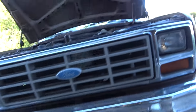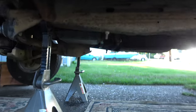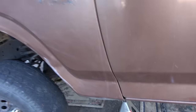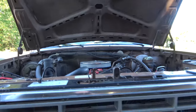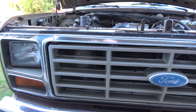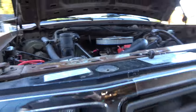I've got the oil pan back in for the transmission with a new gasket - cleaned all the screws and both mating surfaces. The transmission is dropped back down on the cross member and I've got the nuts reinstalled. Now we're ready to put fluid in.